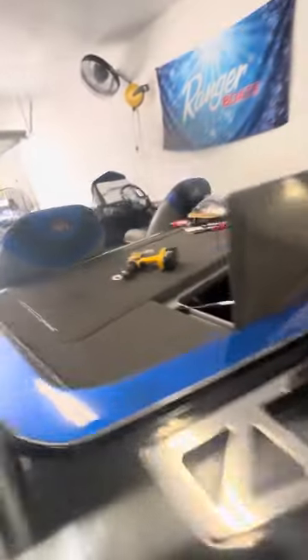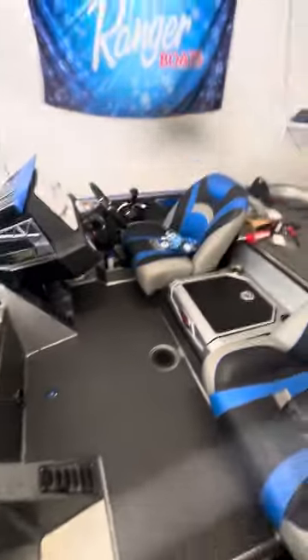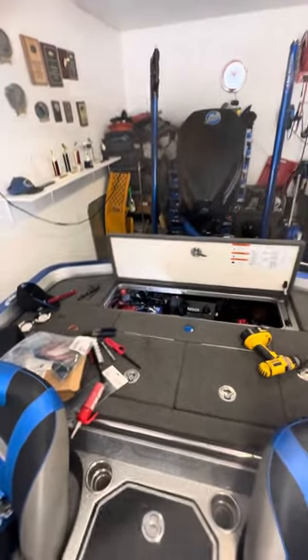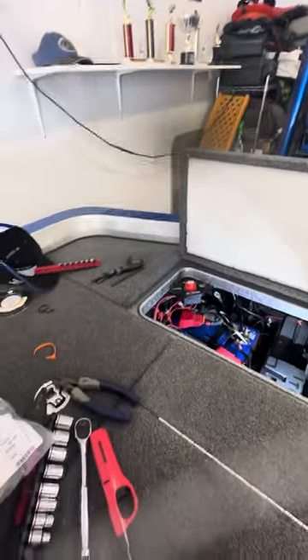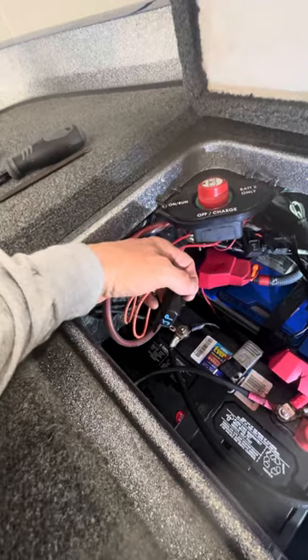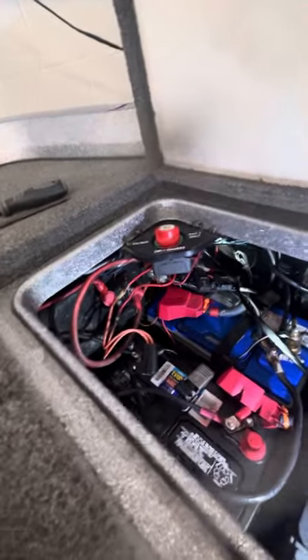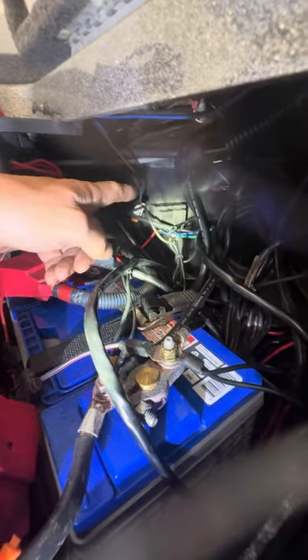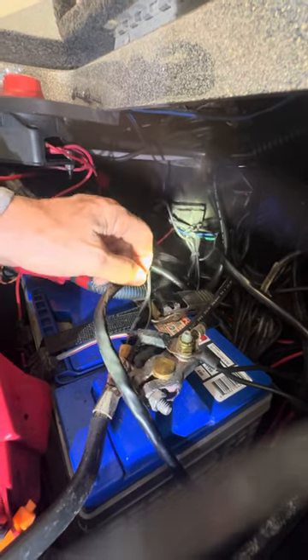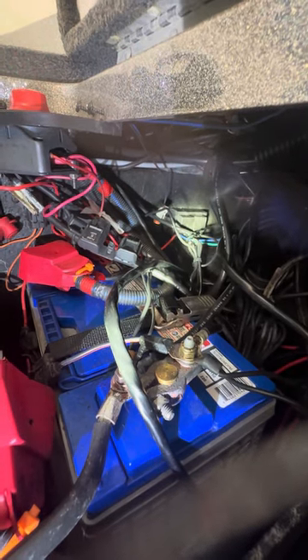What we're going to do today - because of the intermittent working of the relay - I want to show you where it's at. This is the 2018 Ranger 520L, and it's a little difficult to get to. On the fuse I actually painted 'jack plate' on there because I was eating up fuses. I believe it's from that motor I showed you. The relay is back here in the corner, and you cannot access it any easier from going under the rear access plate for the pumps and power poles.